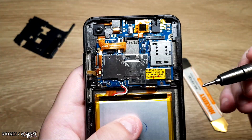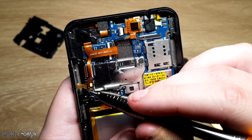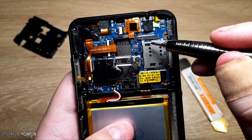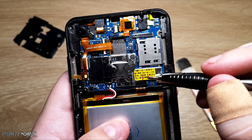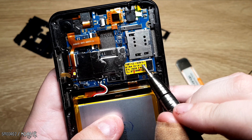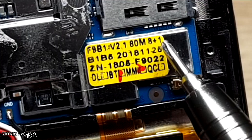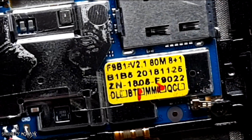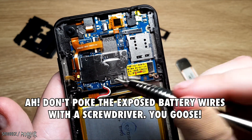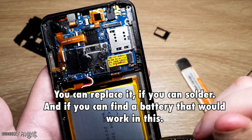There is the board here, which doesn't have any thermal paste by the looks of it. Everything is just poorly placed — this camera here, flex ribbons just hanging around everywhere, the SIM card tray is just here. That there reveals that it is possibly 8GB ROM with 1GB of RAM, which was confirmed in testing. The battery is soldered directly to the motherboard, which is not really good because you can't replace it.